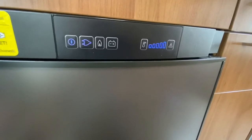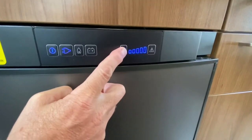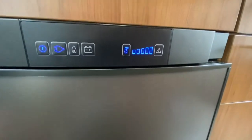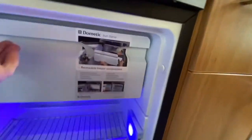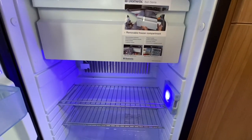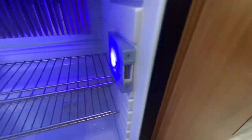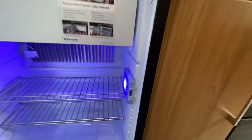It's basically like a cool-box setting. Next to it on this side you've got your temperature dial — all the lights lit up is the coldest. If you do get a warning light you can reset the fridge there. Coming into the fridge, you've got a removable freezer compartment. When winterising or not using the fridge, it's better to clean it out and leave it open to prevent moisture and mould. Slide this forward so it stops the door from closing fully, allowing air around the seal.